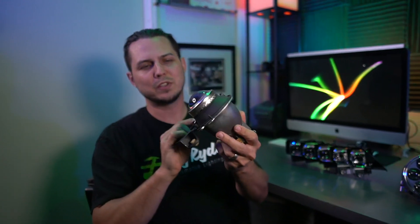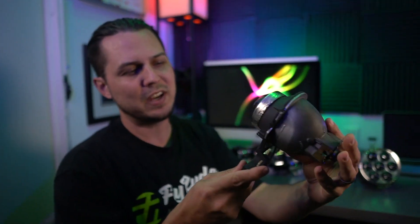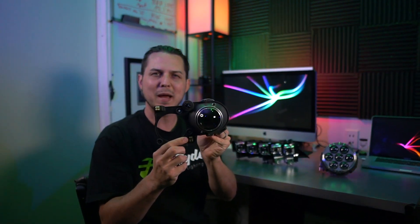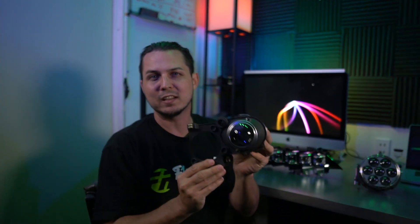This is the last projector I want to show you. This is actually from an S2000 — this is an AP2 S2000 projector, which is one of the best Xenon projectors that ever hit the market straight out of the box. It came on the car amazing, but look at this giant bracket that's on there. This also has something in common with the other two that I mentioned — it goes back to how things used to be back in the day when retrofits were difficult.